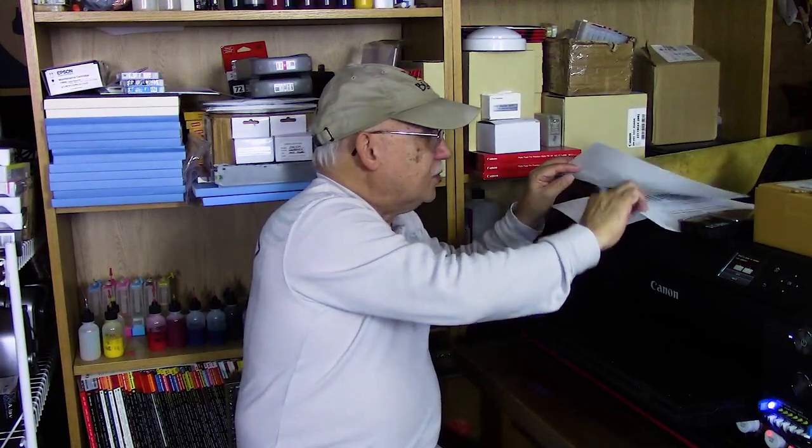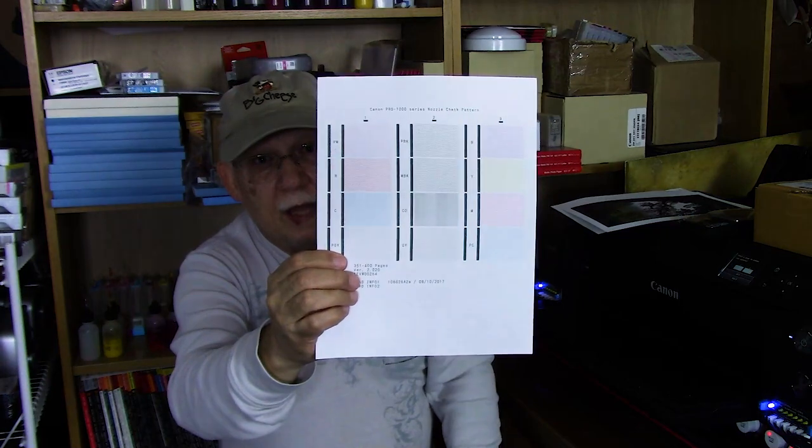And I should be getting results like these — not something with a color cast, banding, or missing areas. If you have a chronic set of clogged nozzles, you're going to get banding — blank lines across the image. Again, do not try to clear that by printing a full document of the corresponding color. Those nozzles are struggling right now — do not put them through the torture of attempting to be cleared by printing, because printing generates heat. Only run a cleaning cycle — a cleaning cycle is just selective application of vacuum.